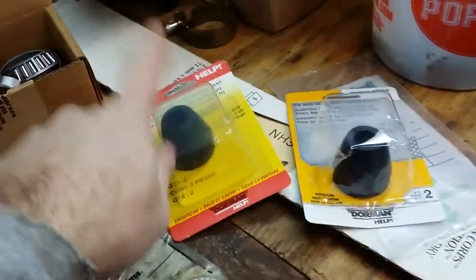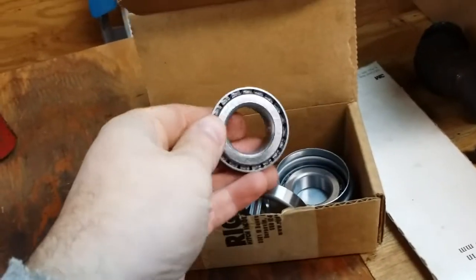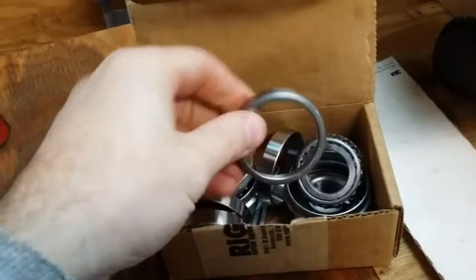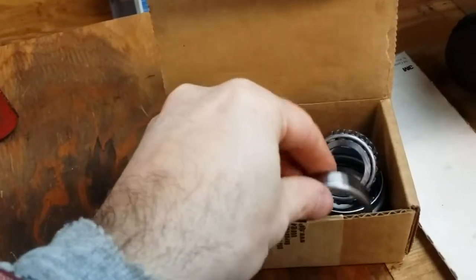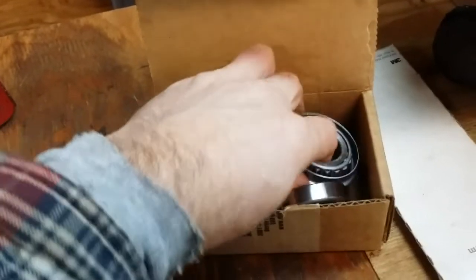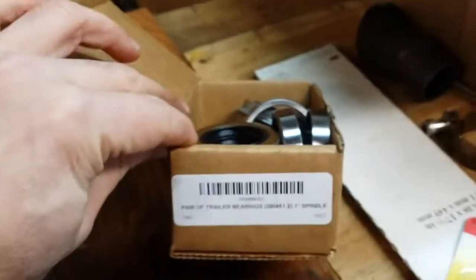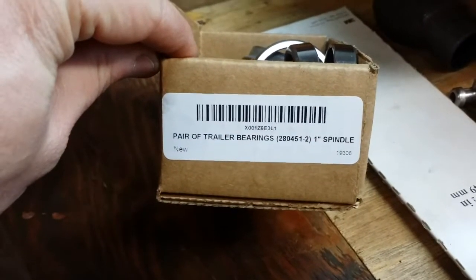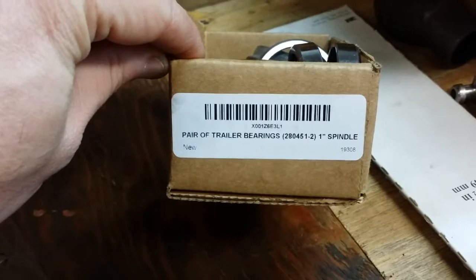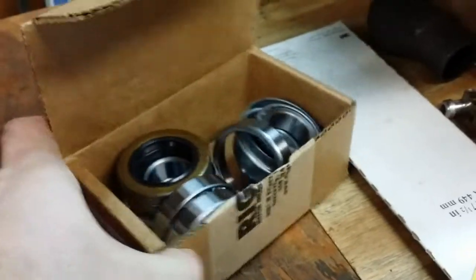As I mentioned, I got new boots for the tie rod ends — two per side. I found them at Advanced Auto and AutoZone, in the Help aisle. For the front rims, I got all new tapered roller bearings — the kit has four new tapered roller bearings for a one-inch shaft, new races, appropriate grease seals, and brand new trailer-style bearing covers. I ordered them from Amazon — part number 280451-2 for a one-inch spindle — and I believe it was about $24 for the entire kit.